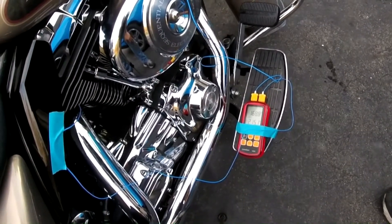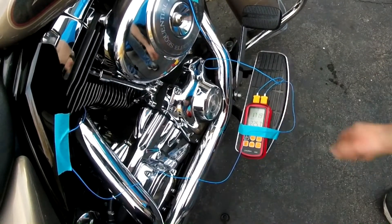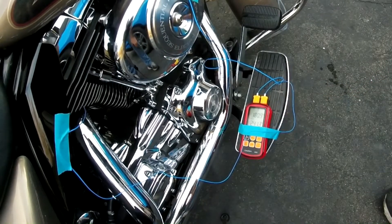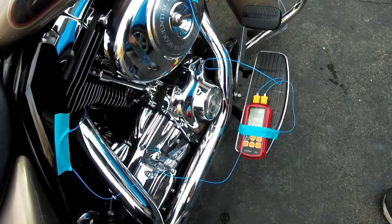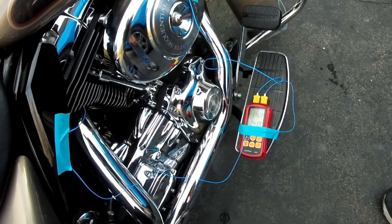She's been running for about 10 minutes and these are the temperatures I'm getting — about 170 in the front, about 230 in the rear cylinder. It's still going up: 180 in the front, 241 in the rear. The rear is steadying at about 239–240, depending on if there's a breeze or not. That's where she's staying right now. I don't want to overheat the engine, so I'll go ahead and kick the fans on.